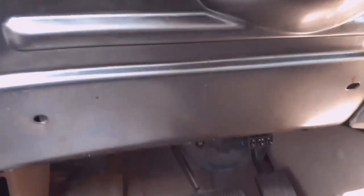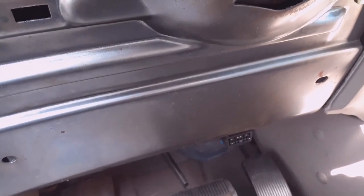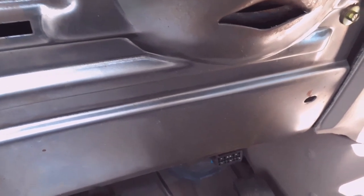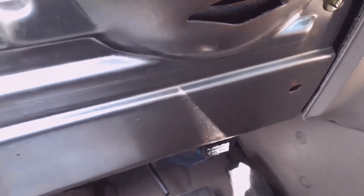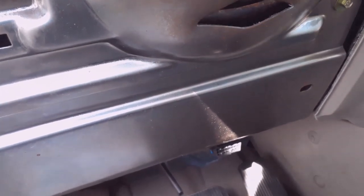Just a clip kind of stuck in there — there we go. Sometimes these clips get stuck. If you're gonna do a job on a customer car or your personal car and you'd like to take care of it, don't use a screwdriver like I just did to pop that out. I suggest using panel poppers — they call them upholstery removers — you can get them at Home Depot, Menards. The end looks like a fork and the edges are not sharp, it's a lot smoother.